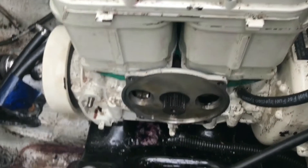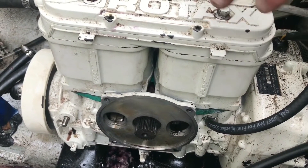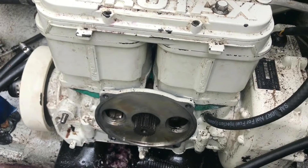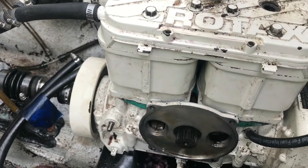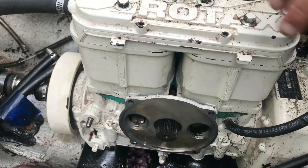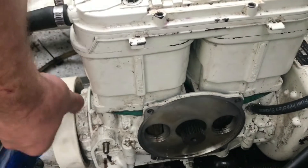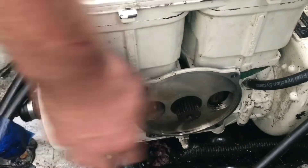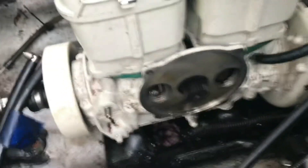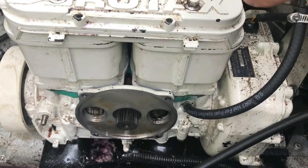Update: I took my little brass hammer — being very careful since there's that brass gear on there — greased up the gear, put the crank on top dead center, and just slowly tapped that shaft in while I wiggled the back pulley a little bit. That helps the teeth slide in. Do it really gently so you don't tear up that brass gear. Once you're done, make sure the motor spins over freely by hand, both from the back pulley flywheel and from the shaft itself. With that brass gear broken off, it was letting the shaft turn too much, throwing it way out of time and causing all kinds of grief.